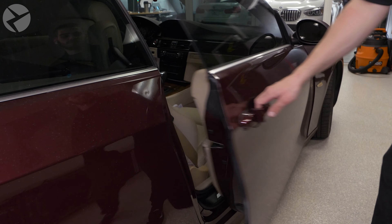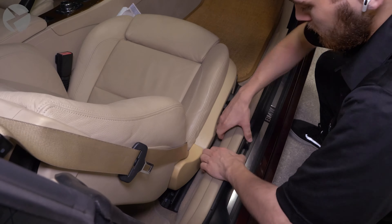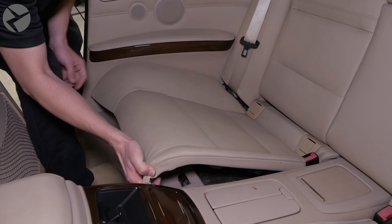To make things a bit easier, you might also want to remove this cover plate by using your trim tool to pop out the two fasteners holding it down. After that, remove the side panel. Rotate and remove the retainers on the battery cover panel and remove the panel. Remove these two fasteners in the upper side trim and remove it.